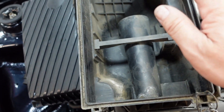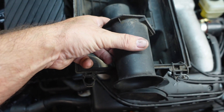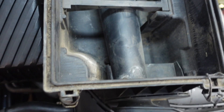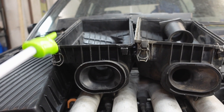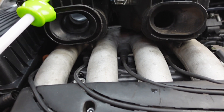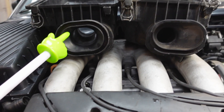I would like to maybe modify this air box at some point. I'm going to do a few tests on the rolling road trying different air boxes and air filters. This is the bottom half of the GTD - you can actually slide this snorkel bit out. To keep it OEM looking, I've got an option: I have one off a mark 3 air box, machined out to sit in the same location. It's larger so it's going to flow a lot better because it doesn't come down to such a small size.